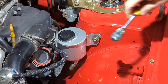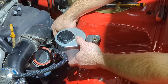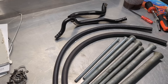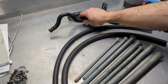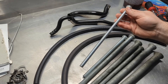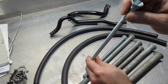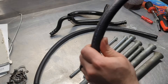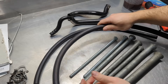Go ahead and pull the reservoir off to clean it. Now I'm gonna show you how I get these intricate bends onto rubber hoses out of straight stock. What I've got here are copper tubing benders — typically you'd insert your copper through here and then bend it so it doesn't kink. If we just kink the hose it collapses, and we don't want that. So I'll take one that fits.